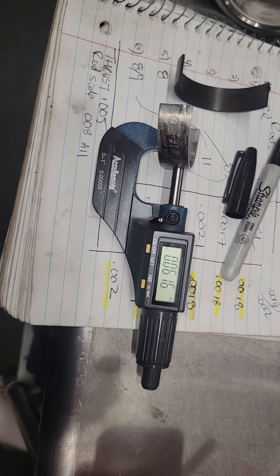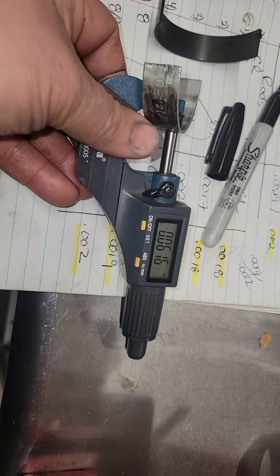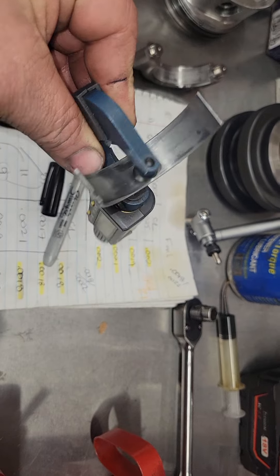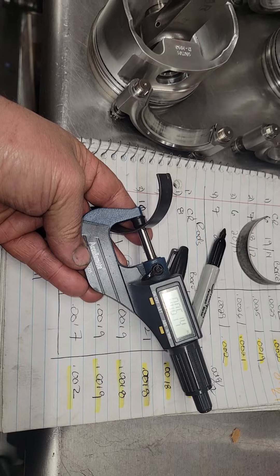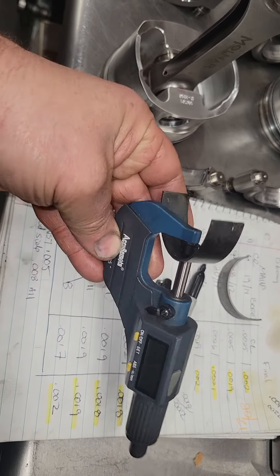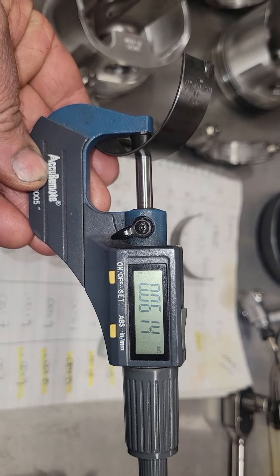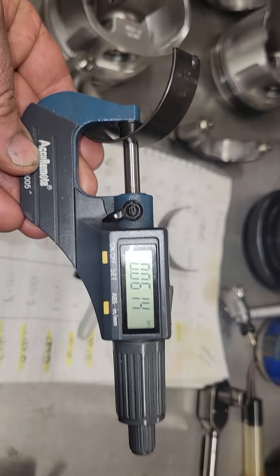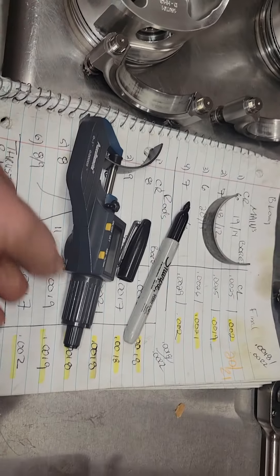Here's bearing number five — one of the number five bearings is Mike's 616. We'll forget about the decimals and zeros, that's what it looks like: 616. Here's a new one: 614 with no marks on it just yet. Keep in mind we're talking ten-thousandths, hundred-thousandths — four places to the right of the decimal. We're really splitting hairs here.